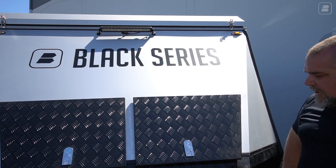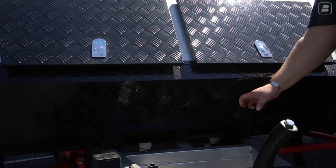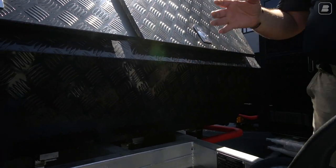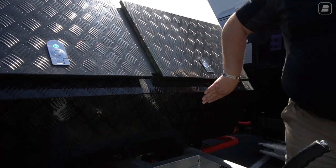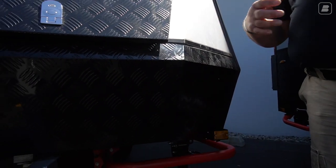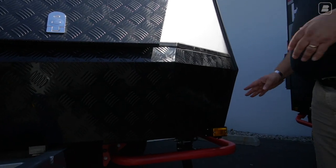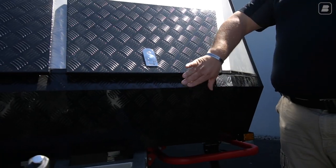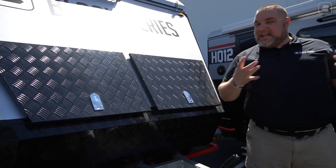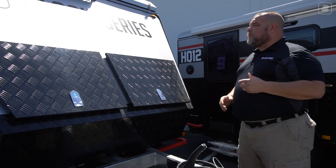As always we're going to start off with our rock guard. We have an angled rock guard made of aluminum diamond plate with a European cut — not the standard American cut. It's got a downward angle and backwards slope so that if you're throwing rocks off, those rocks will hit here and deflect away, protecting your vehicle, rather than bouncing back like a rounded or flat unit would.